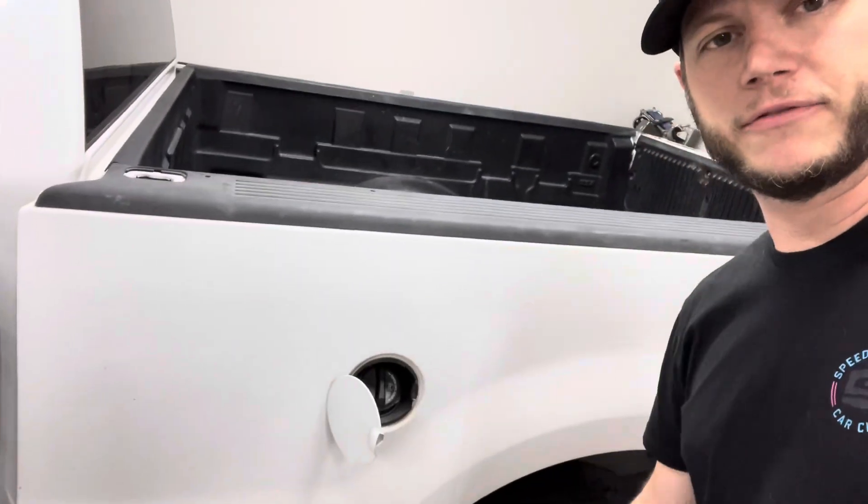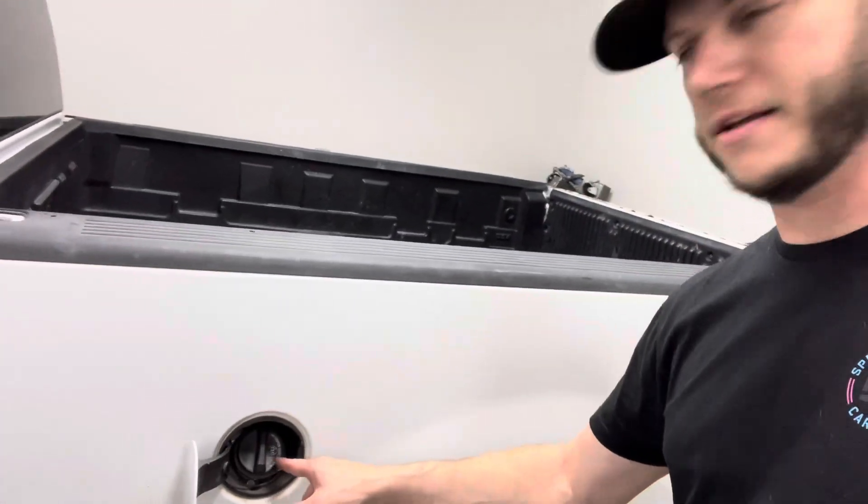Speaking of fuel pump things, I'm going to see if I can add one of my return-style fuel systems like I did with the Mustangs and see if that works as well. It's obviously a returnless system — the fuel pump driver module is actually in the cab. I'm going to let the Coyote computer control that, which should be compatible with the Coyote, just like the Mustangs are.